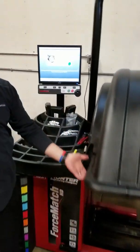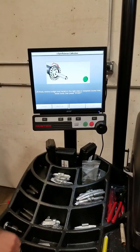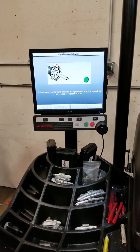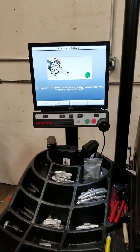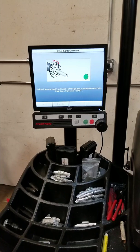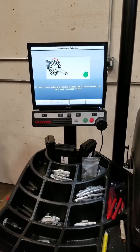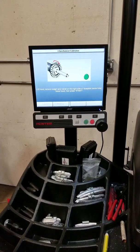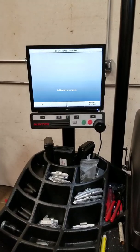I'm going to lower the hood one more time and go ahead and press start, just like the pictures are showing. A big reason why you'd want to check or perform calibration: if you seem to be chasing weights, maybe the 12 o'clock position is off, maybe the weight reading is off, maybe there are wheel weights underneath the balancer, or maybe it's not sitting on level ground. But the number one thing I see that knocks balancers out of calibration — guys aren't using the wheel lift. When they take that wheel and tire assembly off and it smashes down on the shaft, that can knock the balancer out of calibration. The wheel lift saves your back and helps keep the balancer in calibration.